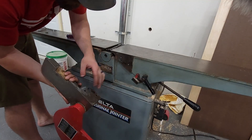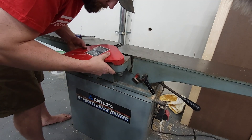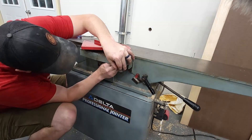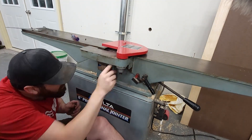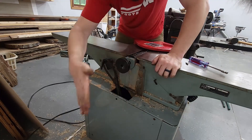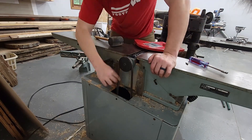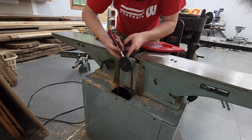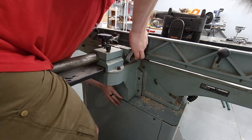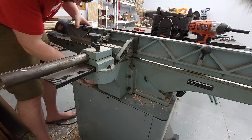At this point we can put the guard back on. There are two pins in there — they came out on the guard side for me, but they should slide back in. That just helps you align everything back in, then put the two screws back in and tighten everything up nice and tight. Now we can put our pulley back on — I used a rubber mallet to really get that on there, then put the belt on. Get both of those hex screws tightened down nice and tight so it doesn't spin. Then get the back on — there are two pins, just like the guard had, that you need to get perfectly in place to help with alignment. Once that's in, put the two screws on each side and tighten down.